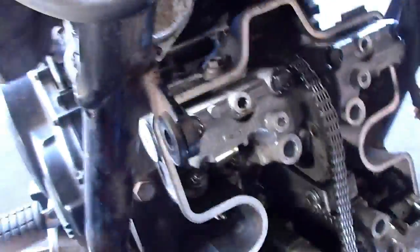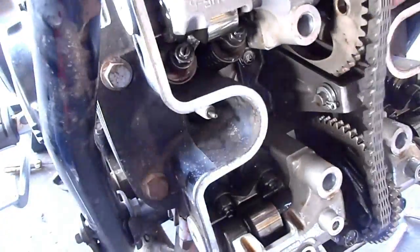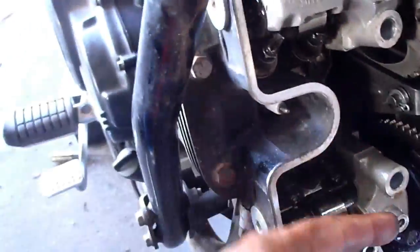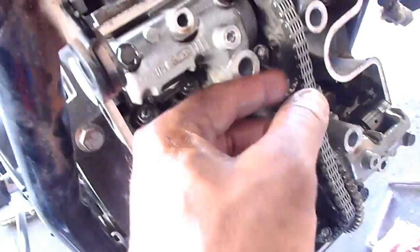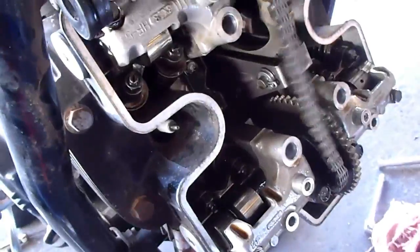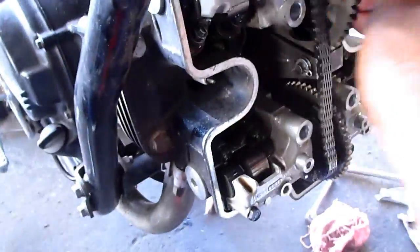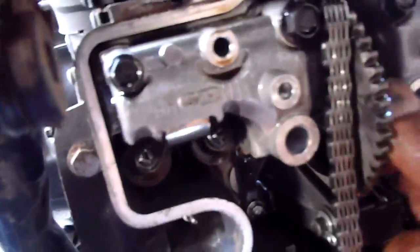So this was a cool learning point - I finally understood exposed cam bracket bolts. You turn the rotor around until these bolts line up, take that one out on this side and one on this side. Rotate it again to get the side that's not exposed around, take that off. Once that pops off, these two are loose and your cam chain is now pretty loose. I loosened these valves up and I can shake this and the lobe is loose - that one's loose, and so is the other one over here.